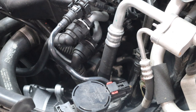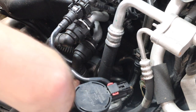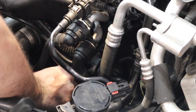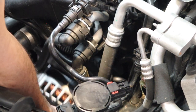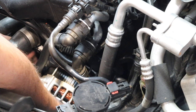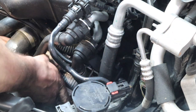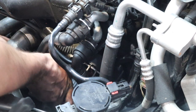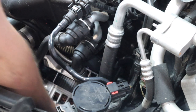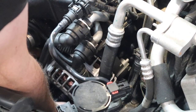Because you're bent over the car and it's not the easiest way to show you. I'm going to go ahead and plop the alternator up into its spot, past these coolant lines. Remember, you do not need to take them out — it will go on past. Just be careful. Once you've got it past the last coolant line, that's when you'll connect your connector.